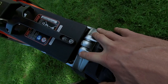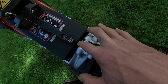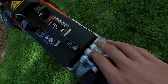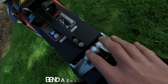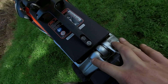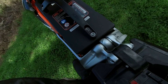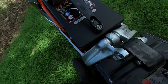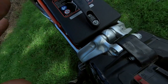The bolt isn't cheap — I want to say it's around $24. It's a special KTM bolt with short threads and a long body. I've thought about having a stronger one made, but I'd rather have the bolt bend than crack the frame or something else that wouldn't give first. So if you're jumping, get a couple of extra shock bolts. You'll know it's bent because you'll see the shock going up and down oddly. It's not a reason to not buy this bike — people online get ridiculous pointing fingers at minor stuff.